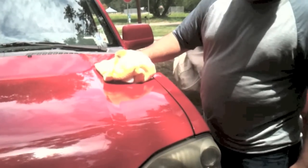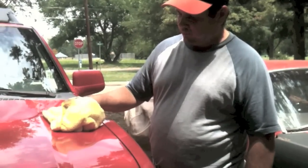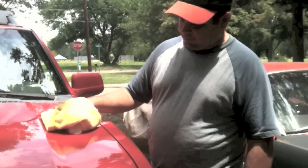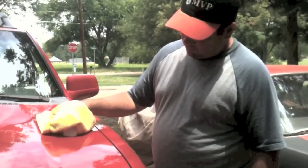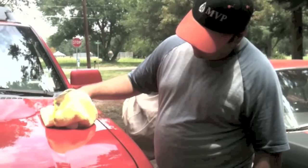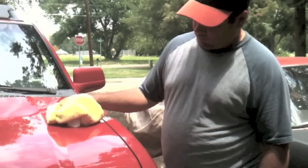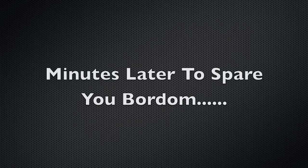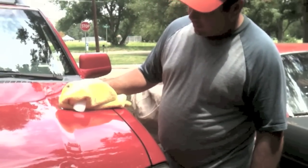This is just a small hail dent, and I've got a piece of dry ice. I'm just going to put this on the dent — you don't want to touch it with your bare hand, so I'm using a cloth. I'm just going to place it on there, right on the center area of the dent, and just let it sit there. I'm going to put more of the tip just in the center part of it. Can't really tell until the metal unfreezes there.